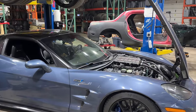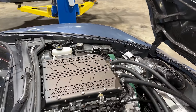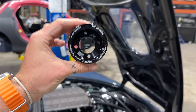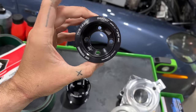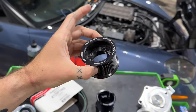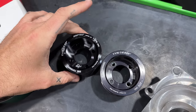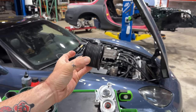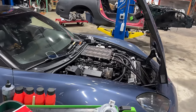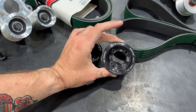As is the case with any supercharged car — if you want to make more power, assuming you already have your cooling system figured out and everything else is working properly, you're going to stick a smaller pulley on the supercharger. If you're not a supercharger guy, you're probably thinking: why does putting a smaller pulley on it make more power? This is the old pulley on the car: 2.625 GripTek by Kong. This one is a 2.5. This supercharger pulley is mounted directly on the end of the blower — every time this spins, the rotors inside the blower spin. The numbers I'm about to give you are by no means accurate, but they'll give you a basic understanding. Say every time this belt completes one rotation, it turns this pulley 10 times. Because this one is a little smaller, it'll turn it 11.